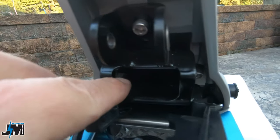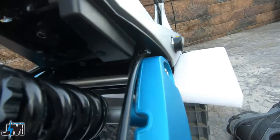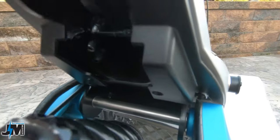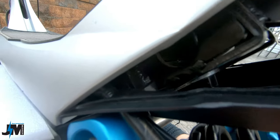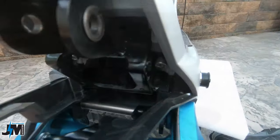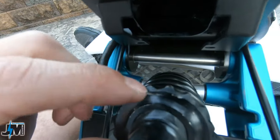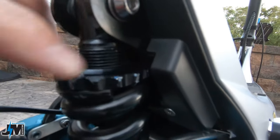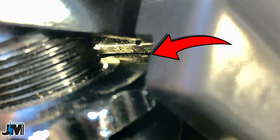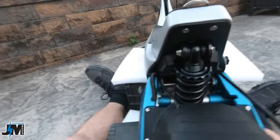I took out the two side bolts — no loctite on those either — put loctite on and reinstalled them. Tightened the shock up exactly one complete turn and now I have about a sixteenth of an inch gap between the top of the nut and where that bracket comes down. That'll give enough clearance so it won't touch. I put blue loctite back on and got it all back together. The two bottom bolts I couldn't reach, but those six bolts hold the back bracket where the whole rear end — swingarm and shock — attaches, so make sure they stay tight.